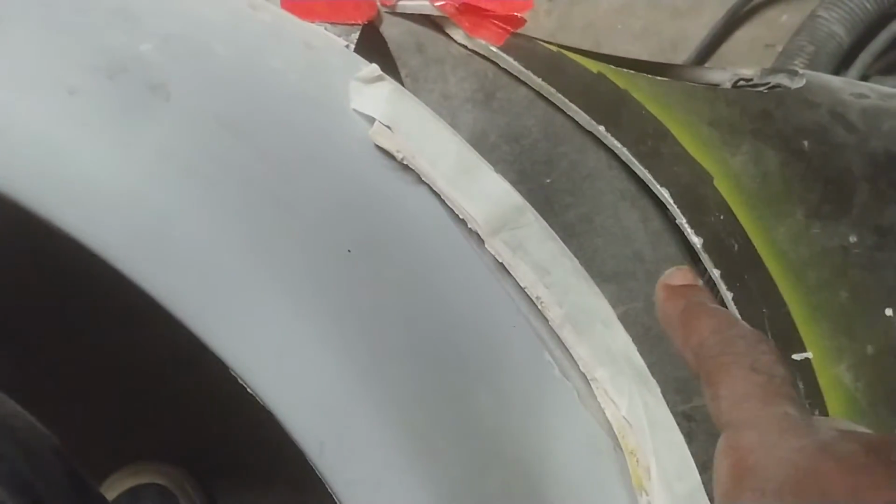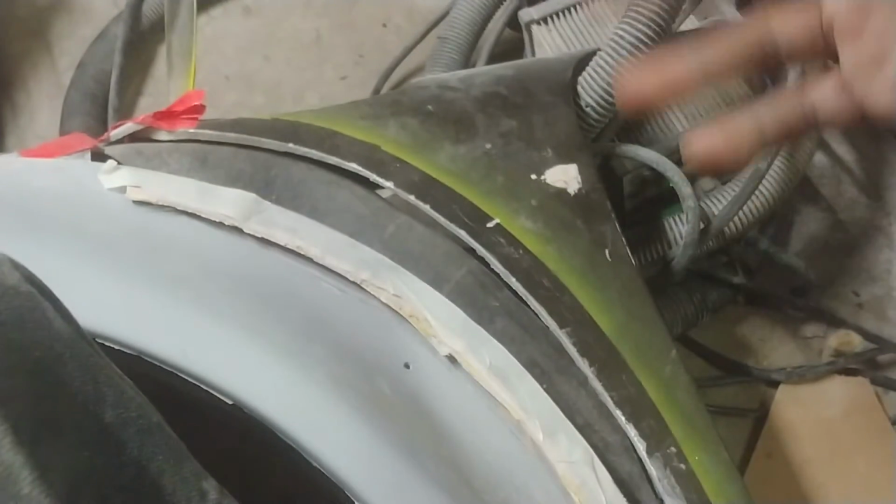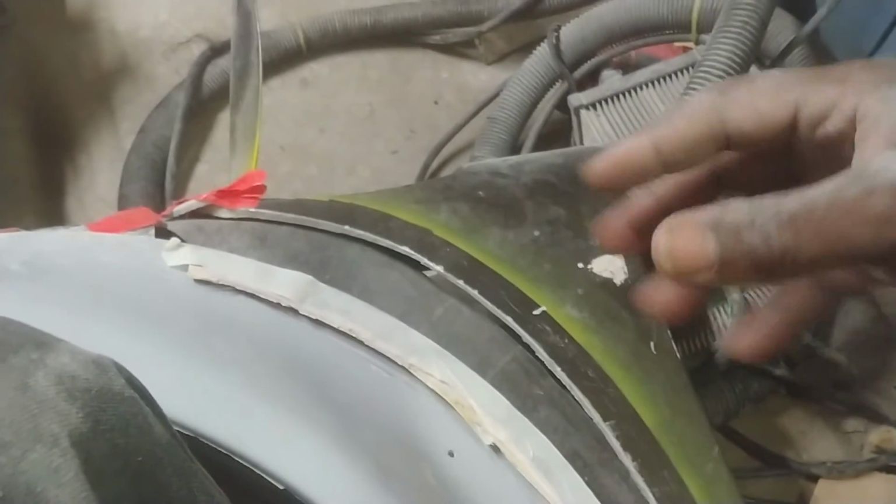No foam. My cost for that piece is what? Pennies, because basically it's a $20 roll. I just use a scrap piece from other projects and a razor blade. And then, like I said, the way I did it, I can duplicate it with the other piece that I have on the other side. Just literally contour it on the flip side and do the same thing for the other fender. And then once you have it glassed, I don't have to tell you the rest. You know, do your bodywork, your Bondo, whatever, shape it, skin it with carbon, make a mold of that actual piece, make a carbon piece, whatever you want to do. But basically, it is that easy, and that's how I get my fabrication on.